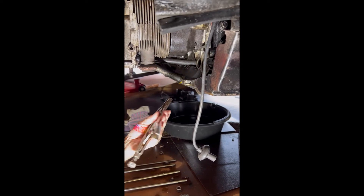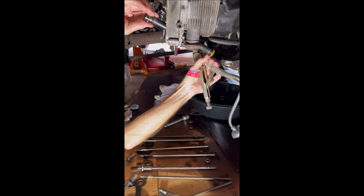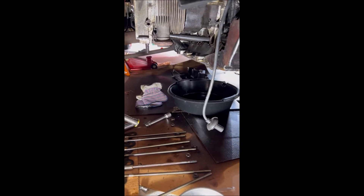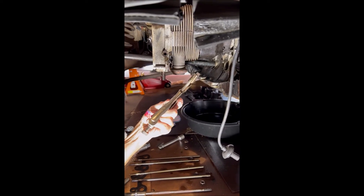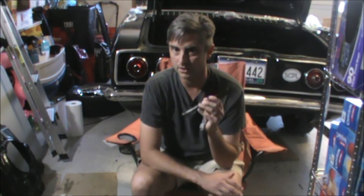I've got a little clip of us removing them — I'll show that here. So here we are removing the pushrod tubes, source of many oil leaks on Corvair. Those don't look like Viton. No, they don't. Well, that one was cooked. They don't usually come out that easily — usually you have to hit them. Oh my God, these things must be ossified. No wonder it's leaking so much oil. But it is an important job. You need to do it — it'll save you a lot of oil leakage in the future.